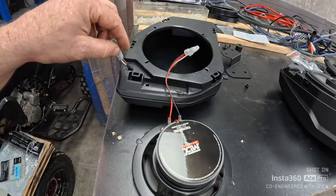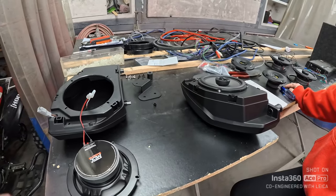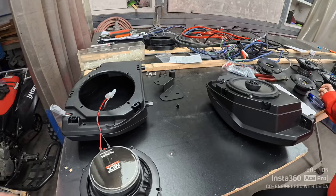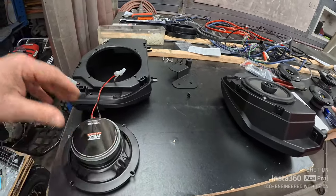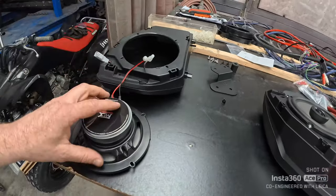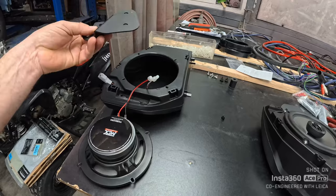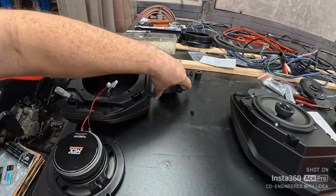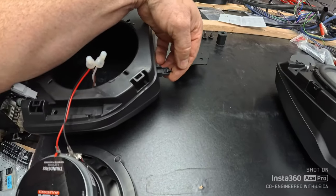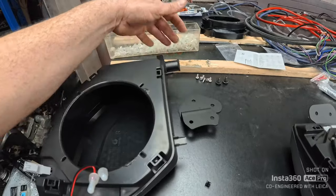If you do not have this pigtail, the left rear positive is the brown and blue, and the negative is the white one. The right rear positive is the pink and the purple, and the negative is yellow and gray. Those are your stock factory speaker wires in the vehicle. Since we have these pigtails, we've already determined that the brown will be the positive. The speaker will then go in with four screws. This bracket here — you'll reuse your factory screws from your stock boxes to install the new bracket. You will need this clip off of your factory box, and it will push on to this little ear here, and then the spacer goes on this little pigtail right like that.